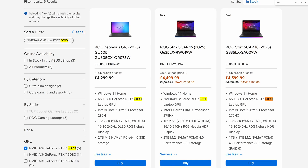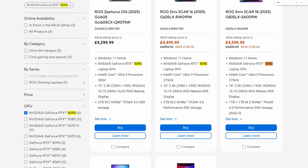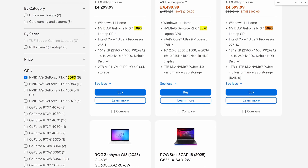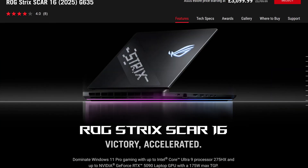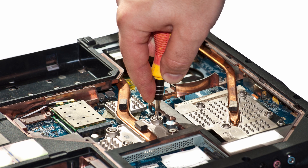But it's not really accurate to say there's an RTX 5090 in the laptop, because the ones in a laptop are massively cut down — they are nowhere near as powerful as a desktop one. You're not going to get a laptop RTX 5090 consuming 600 watts of power. The ones in a laptop have been cut down, they consume less power, and as a result they produce less heat. So that is how a gaming laptop can have a graphics card inside — it's not actually a graphics card; it's a GPU with a custom cooling solution.